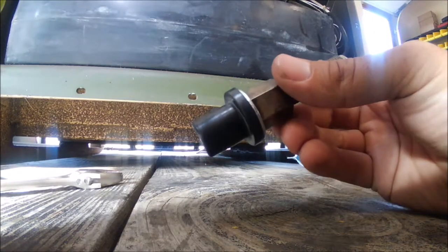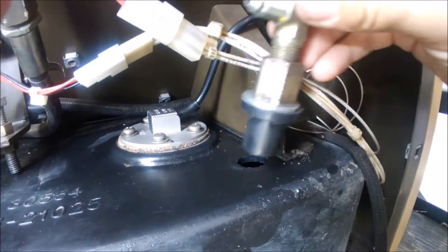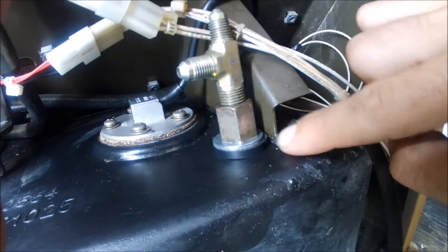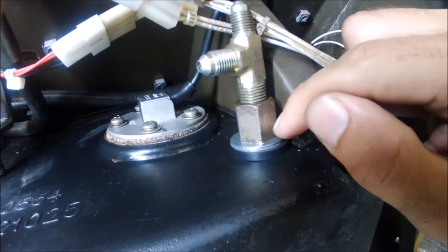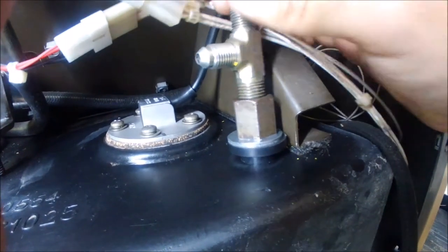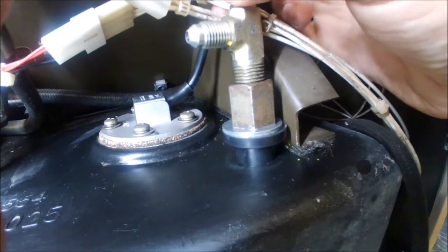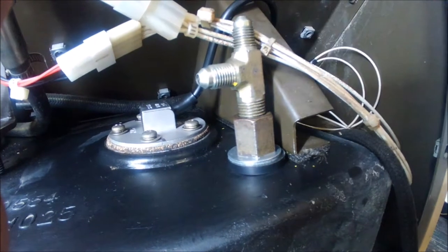You can see it — okay. This is not going to be an easy thing to do, but with it hand tight it should go in there snugly. Once it's in there you'll probably need to hold with one hand and turn with the wrench. You're not going to make it super snug — over-tightening it will make it leak. The idea is as you tighten, that brass nut is going to come closer to the top and make the rubber swell so it seals in the hole.